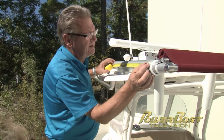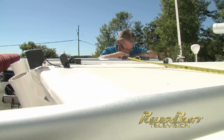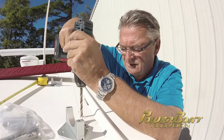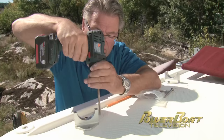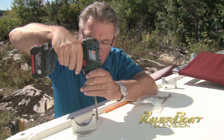Again following multiple measurements, the assembly was set in its final position and the forward mount locations were marked. At this stage the remaining holes were drilled in the aft mounts, then all of the holes in the forward set — and remember to run the final bit in reverse first to avoid cracking the gel.